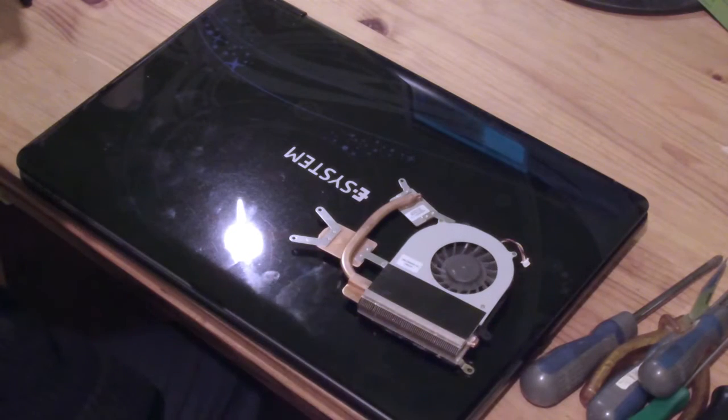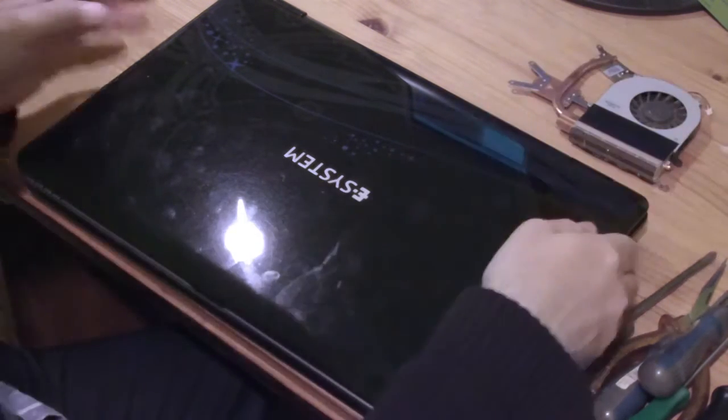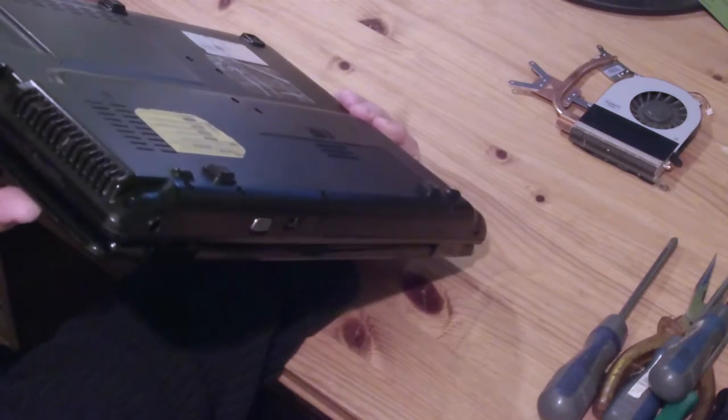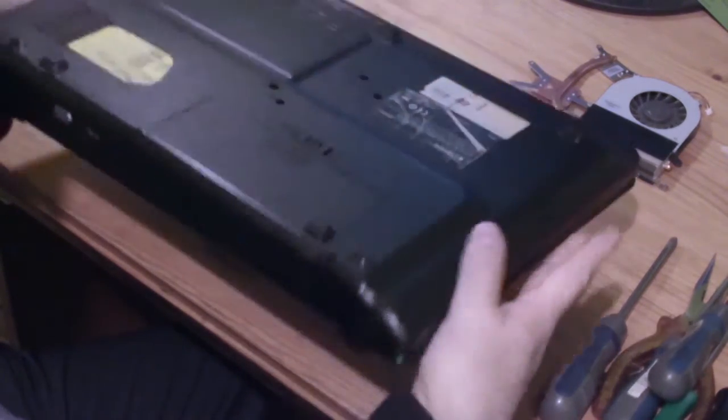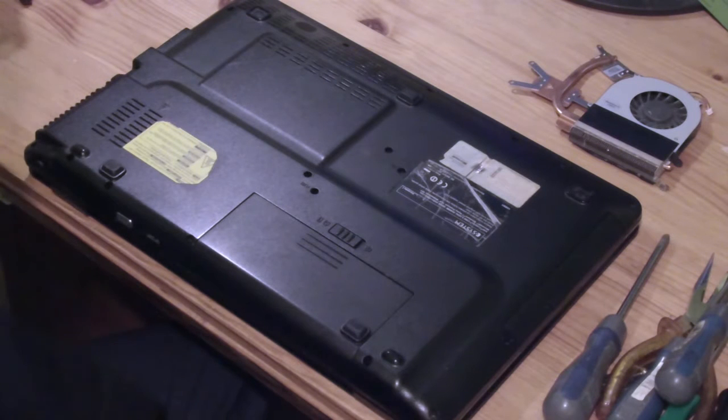You can be pretty sure it's the cooling fan which is not working, because when you hold your hands beside the fan output, you feel no air. Plus, if you sit it on a table with a desk fan blowing into that slot, the machine does not cut out. So I guess it's the cooling fan assembly that needs to be replaced.